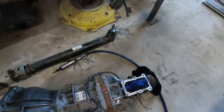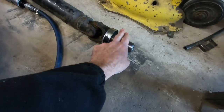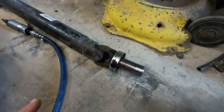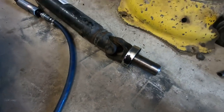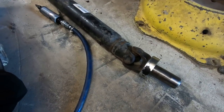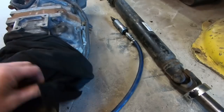If you are changing from a G-series or a W-series — the small gearbox — you do need to change the yoke; they are a different size. Much bigger yoke on the R-series boxes. And if you're looking for an R154 yoke, a late model Hilux will do the job, making it quite easy to find yokes — instead of going to people who want absolute moonbeams for an R154 yoke, you can get a late Hilux yoke and it'll fit just fine.